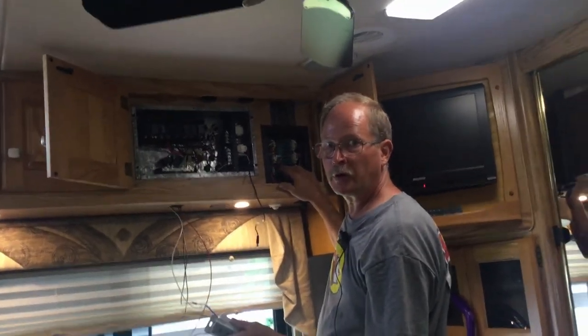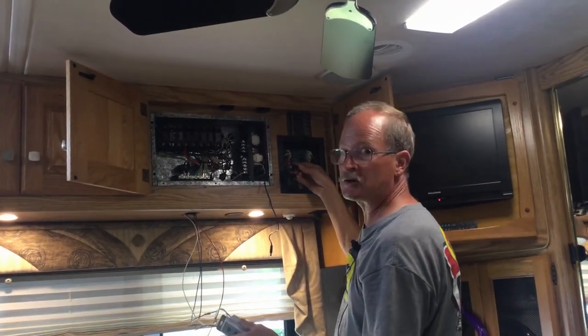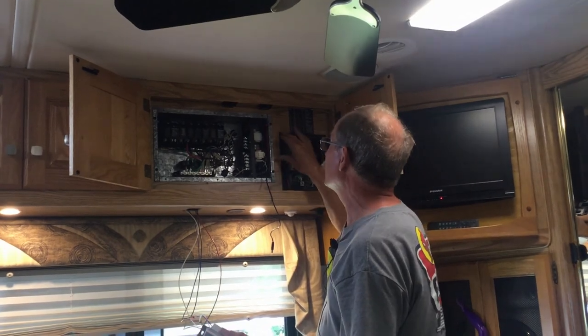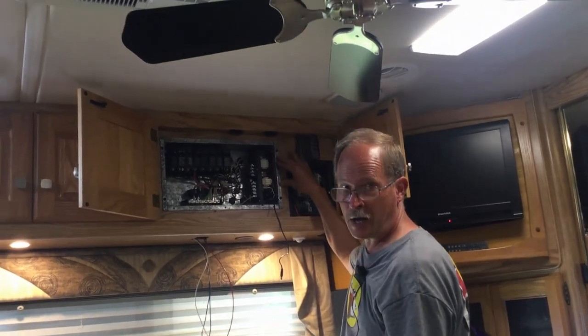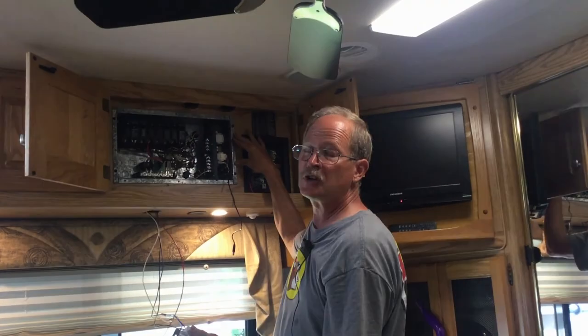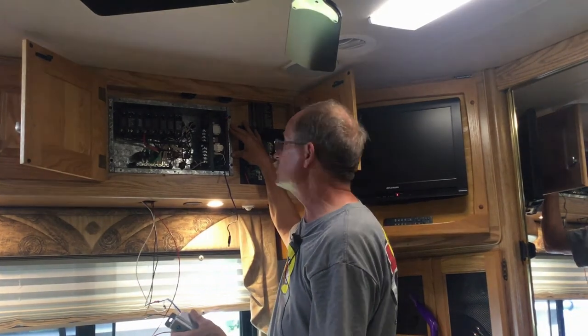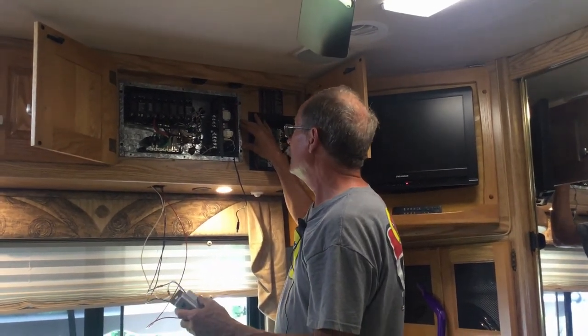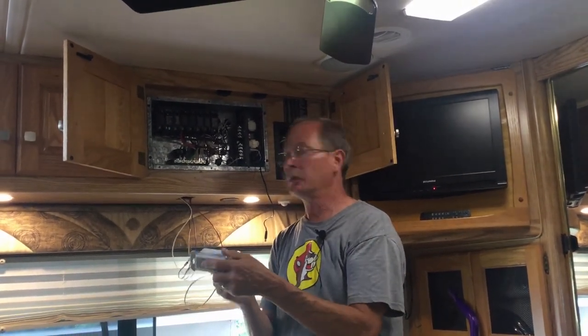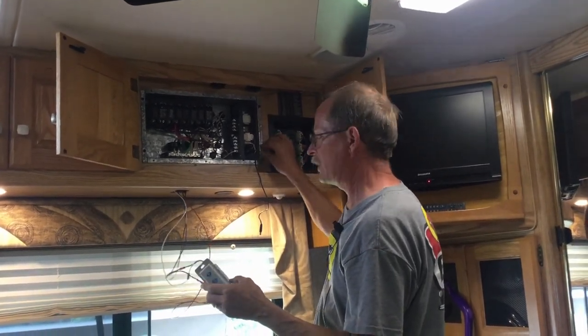I ran out all the wires and put a jumper on my circuit breaker for the power supply — it's fused, and you can get those at the auto parts store; it just plugs in so you can add a circuit without any problem. I grounded it to the panel box. Even though this is a 115-volt panel box, it's still grounded to the chassis, and the chassis is the ground for the DC current and the whole motor coach. So I have a ground from the motor and a negative ground from here, both connected with a crimp connection and eyelet screwed into the frame.